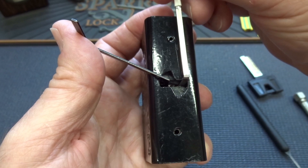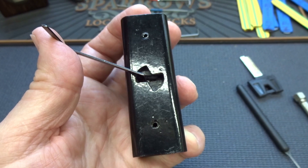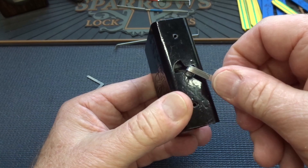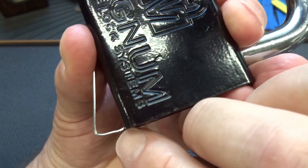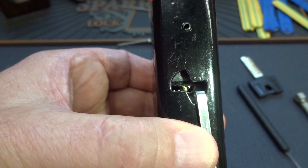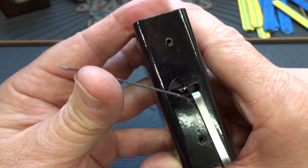There's got to be a way around it. Now the way I've seen people do it is you take another tension wrench, slide it in there, and lever both sides, which gives you access — but then it precariously hangs out there. I've seen guys use tape to hold it in place, but I've got a better way. I came up with this little tool made out of a windshield wiper insert. All I did is put a bend in it, stuck it in there, pulled the shutter down, measured how far it needed to go, then put another bend with a little angle to act like a clothespin to hold that shutter down out of my way. You can see it really gives us super access. Now we can put our tensioner in and we have wonderful access.